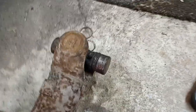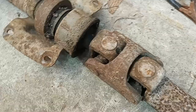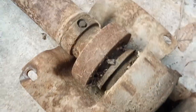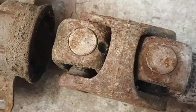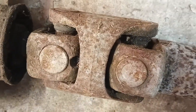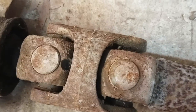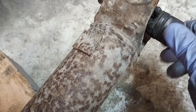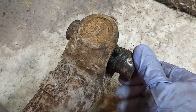They're a multi-piece drive shaft. So that's a piece that goes into the transmission. You've got the center bearing here, and then you've got this CV joint which can be taken apart in service. They don't recommend you touch it though, because it's like a balanced unit and it's in good shape. So I'm going to refrain from taking that apart. But the rear U-joint that goes into the rear axle — that's the one that gets all the road spray and the dirt.